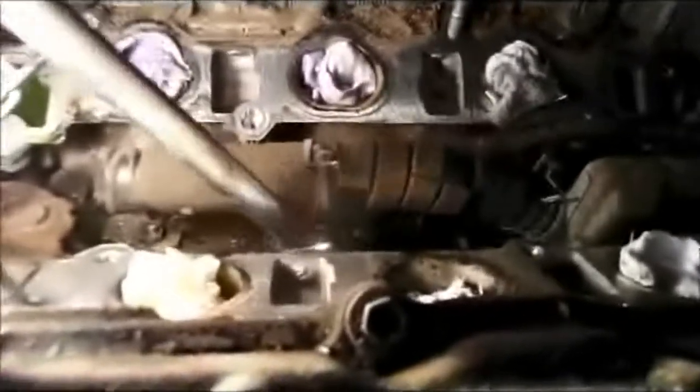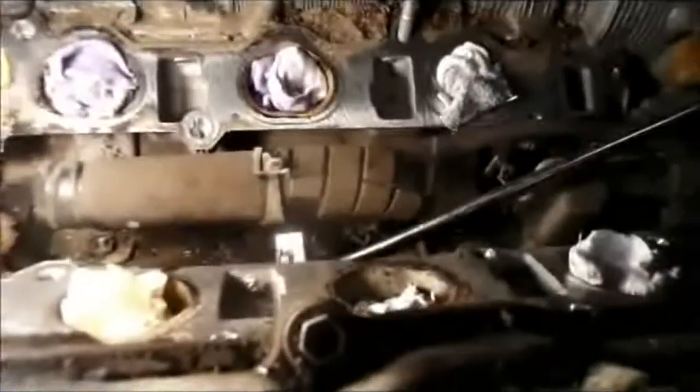And the way you unplug the electrical connectors here is you just push these together. And I need 2 hands to do it. You'll just squeeze them together, and then this just pops right off. And then we just unscrew the sensor from the block, and we'll screw the new ones right back in. They just screw right out. So let me replace these, and we'll come right back then.